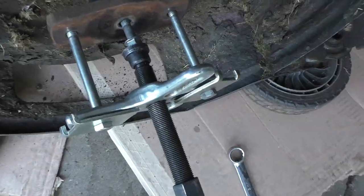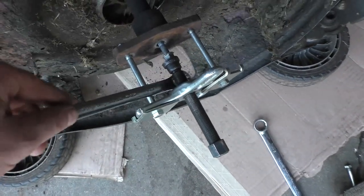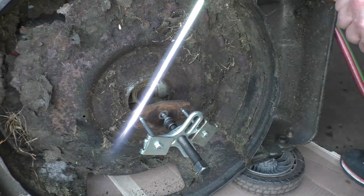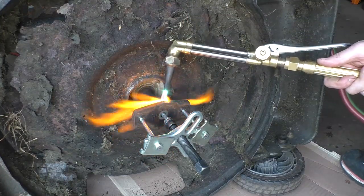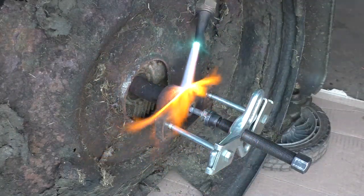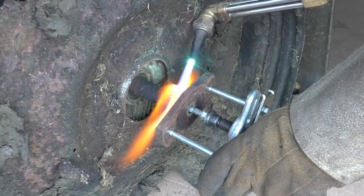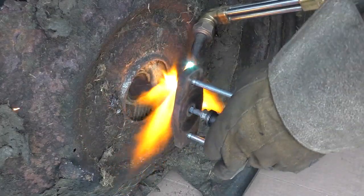At this point I'll use the oxy-acetylene and heat this up. I've put a shorter bolt here. A good tip: if you don't have an impact to tighten this up and you have to hold it, you can lock it in like this with another wrench. And if you're going to do this, make sure you have removed all the fuel from your machine.